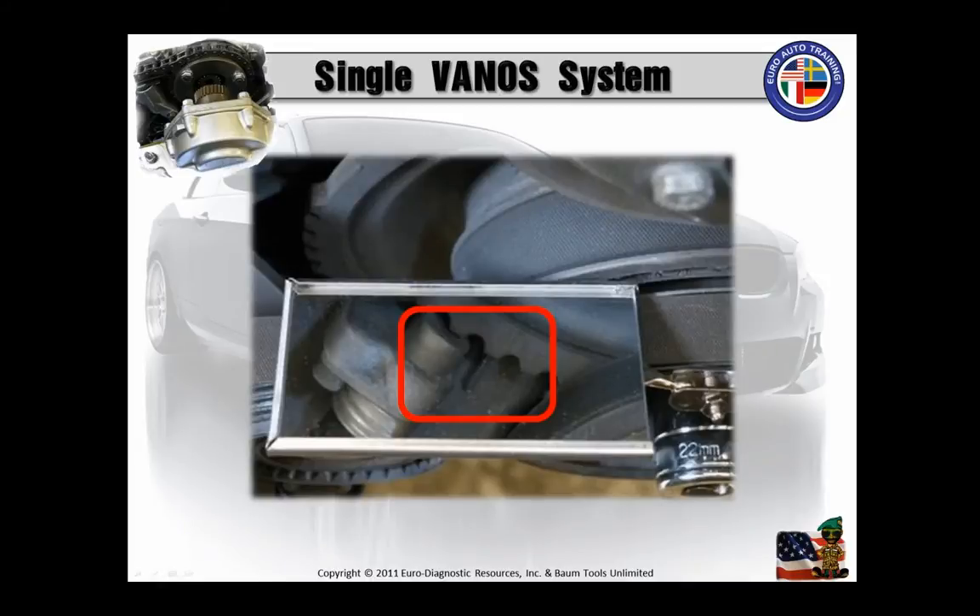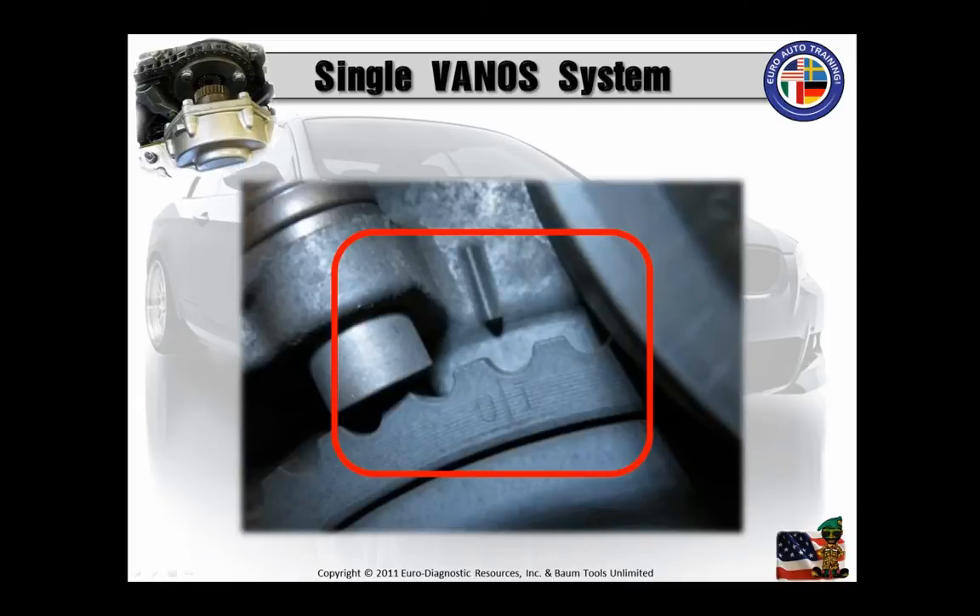Now it's time to check the timing marks. Using a mirror at about 11 o'clock, you should be able to see the timing mark and the hash mark on the timing cover. You basically tilt that mirror at about 11 o'clock position to provide the correct alignment view. Once you've done that, there's a nice close-up shot of the TDC mark — or OT as it's technically called. You should now have everything in place and in the right position to start putting that alignment tool in the flywheel into its place for a nice snug fit.